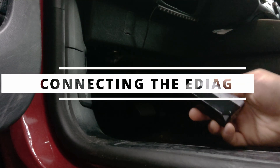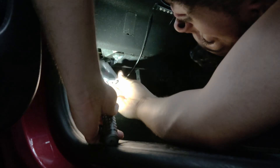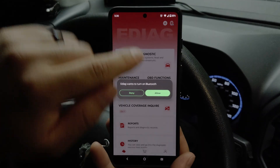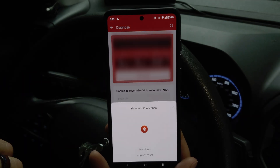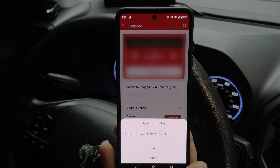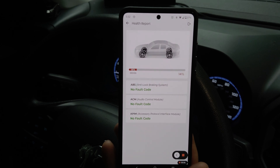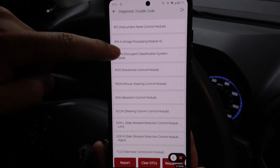Taking a look at the E-Diag now — same idea, a little bit more difficult because we don't have that built-in flashlight, but same idea: plug it right into the OBD2 port. Launching the app, we can see a Bluetooth icon in the top right corner. Tap on that, click Allow, and it'll automatically find our scanner. We'll start with our diagnose — it successfully found our Bronco Sport and here are our functions. This is similar to the system scan, finding all the features our vehicle has on board as well as giving us a report of any DTC codes.